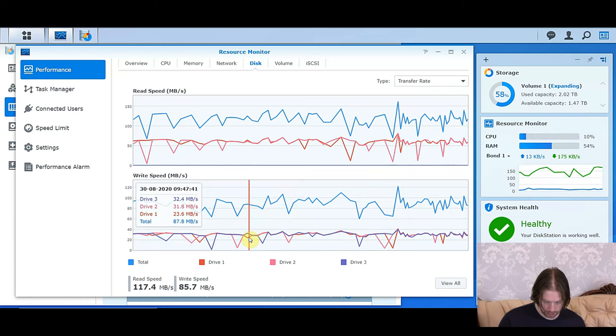So if you have physical access to your Synology storage box, what I suggest is you put one drive in, do the expansion, then put the second drive in and do the expansion again. That way you immediately get expanded storage if you're really running low. If you've got plenty of space spare, then it's fine — you can do both at once. But if you feel like you could easily run out of space any moment, I would suggest doing one at a time. It might take longer overall, but you then get an instant storage boost. If you haven't got access to it, definitely do it all in one go — it works perfectly well.